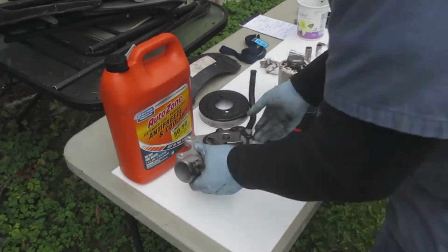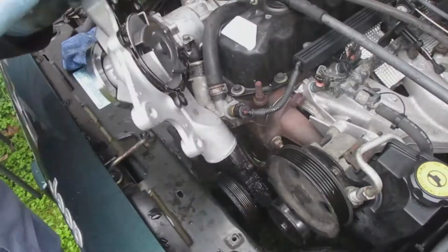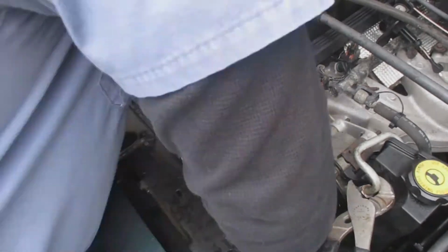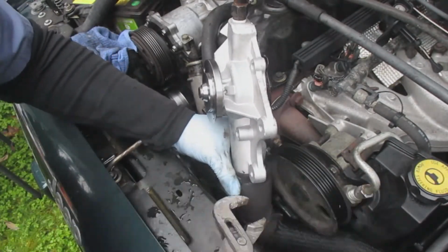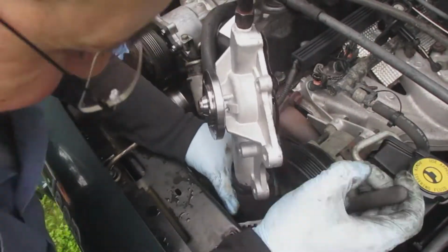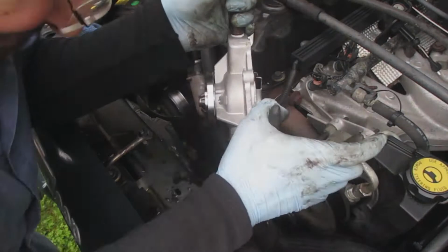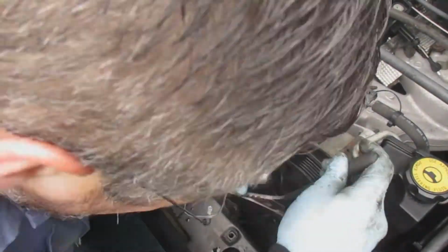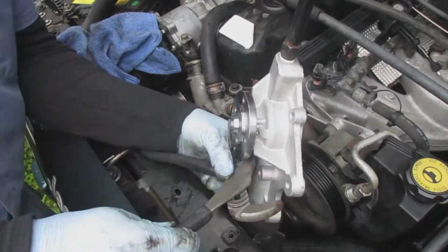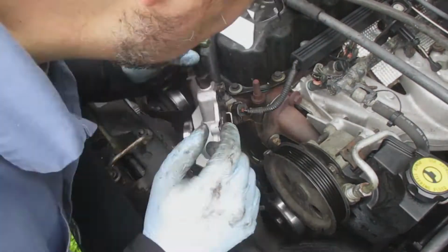And the goo that I put on this is Permatex. It's an aviation kind of gasket sealer. And then I put it onto the water pump, put it inside the Jeep, and clamped that hose, which putting that clamp back on was quite the chore. I think that was probably the hardest thing of the whole project. Like I said before, it's relatively easy to do this. I guess I could have just grabbed a hose clamp and tightened it on, but there you go, put it on there. I'm going to loosen it up and move it just because of the position.